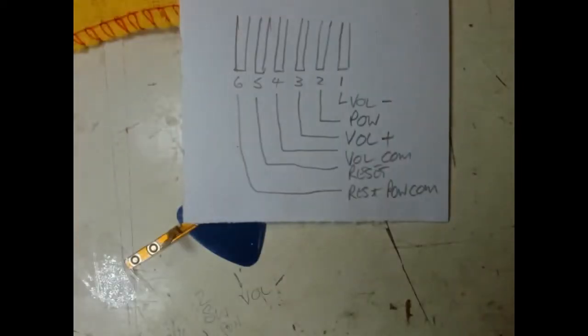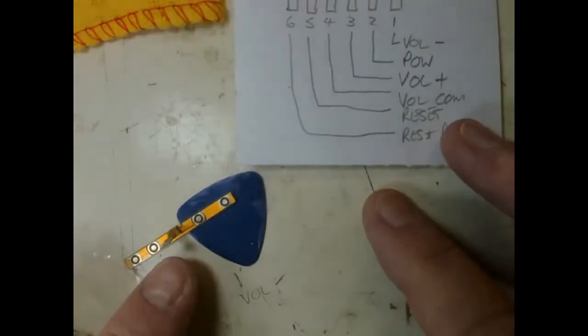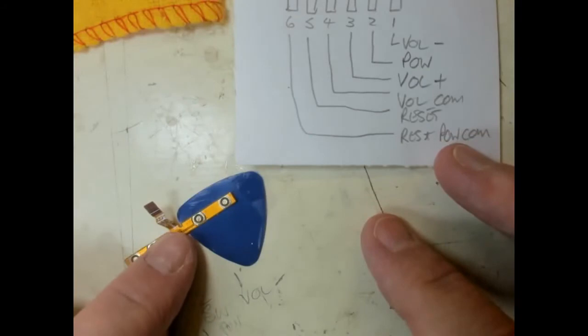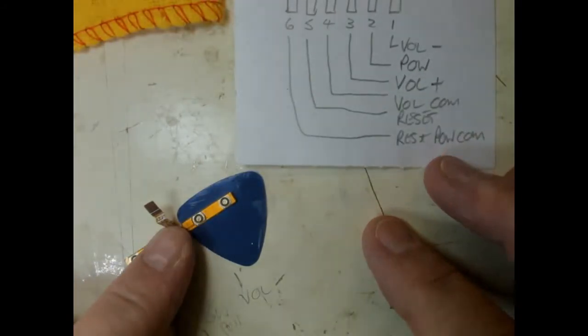So what we seem to have ended up with on here is the pin outs: pin 1 is volume minus, pin 2 is power switch, pin 3 is volume plus, pin 4 is volume common, 5 is reset, and 6 seems to be the reset and a power common, which although the two connect to each other are not connected on that ribbon. So I suspect that ribbon cable is where the problem lies. Now,